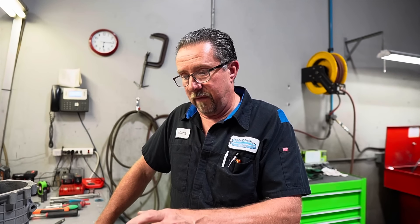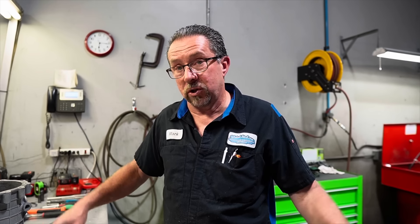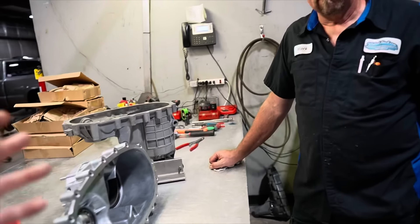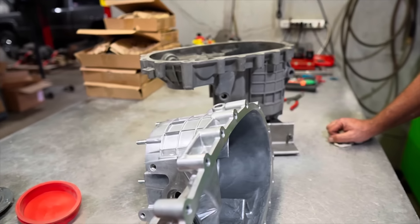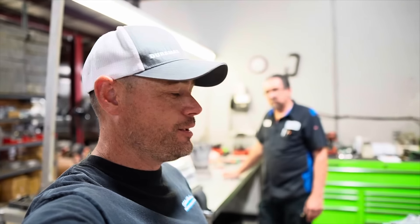Our rear housings are heavy duty — heavy cast aluminum. The areas in the pump rub zone on our aftermarket housings are a lot thicker than the factory ones, and I give a lifetime warranty on pump rub. We've just gone to lifetime warranty on our XHD and HD series cases. When we talk about pump rub, we're talking about the actual pump inside the case hitting against the case over time and eventually putting a pinhole through the rear of the case. It's very common. Let us know in the comments if you've done a case saver — how long has it lasted?